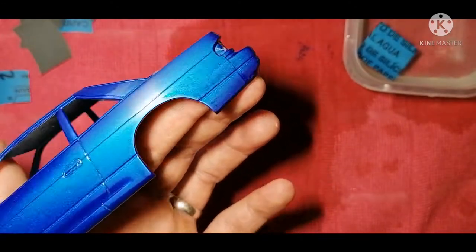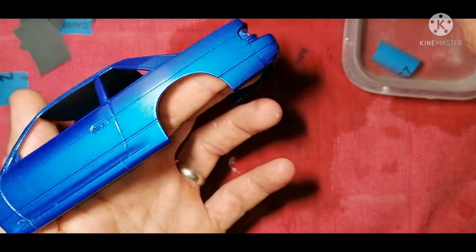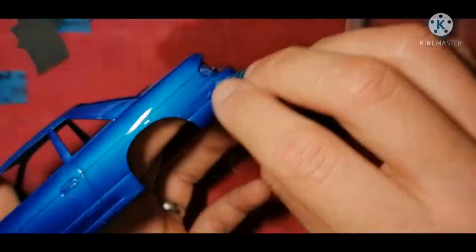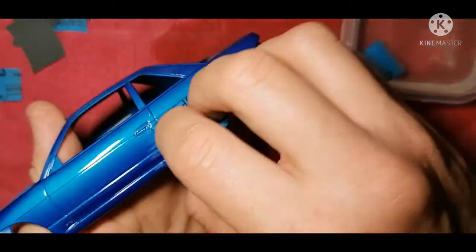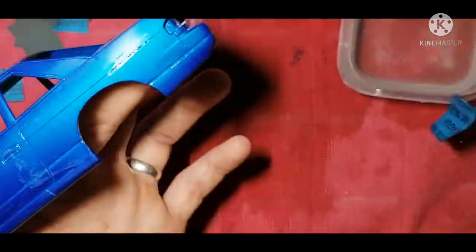The more you do it over time you tend to feel the difference. Because you're not applying much pressure you can get a great feel for the surface. When you first start wet sanding you can feel the texture of the clear — it feels rough. Over time you start to feel it getting smoother, so the longer you go between sanding and drying increases as you get used to it.